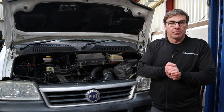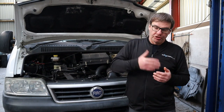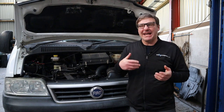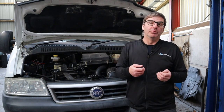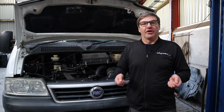So if you've got a pre-2002 Fiat or Peugeot motorhome, make sure your scuttle's clean all the time. The other thing you need to look for is service records — check it's been serviced when it should have been. The main one is cam belts: cam belts should be changed roughly every five years or 60,000 miles. Because motorhomes don't do the mileage that cars do, we normally go off five years, and that's where people get confused — they look at the mileage rather than how long ago it was actually changed.